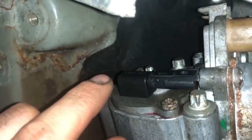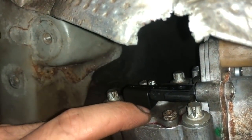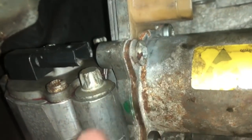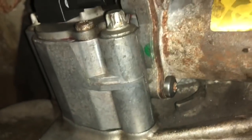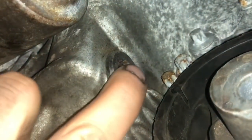And then, as I showed you in the video, you have to take this off and that one off to remove this cap. There's an O-ring under here. There's also an O-ring on this piece where it slides in, and there's an O-ring on this side where the gear is. Also, all your fluid is going to probably leak out here. So, if you want to add fluid, you're going to have to go to this plug here.